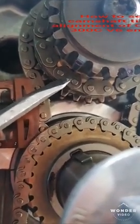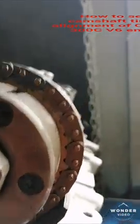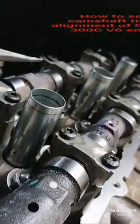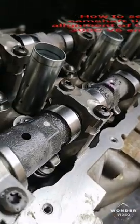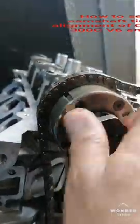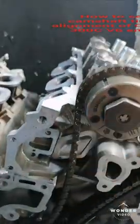This portion of the timing chain is bronze color, while the other one here between this bracket is also a marker. This side — the cam follower is going up. This side of the camshaft positions itself. Now I will install this bracket. It was not in the correct marker position, so I will return this. Now this is the correct position — intake side.